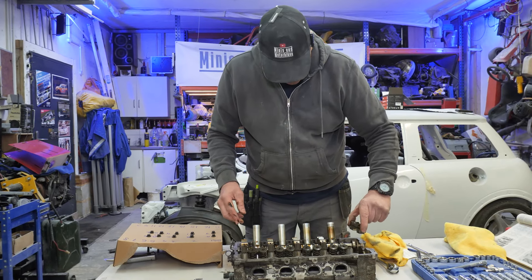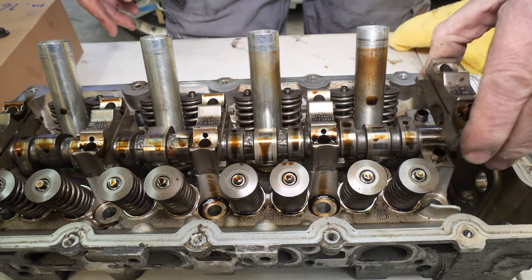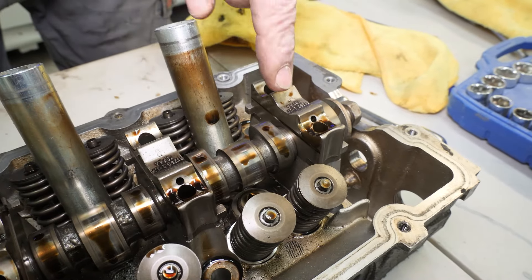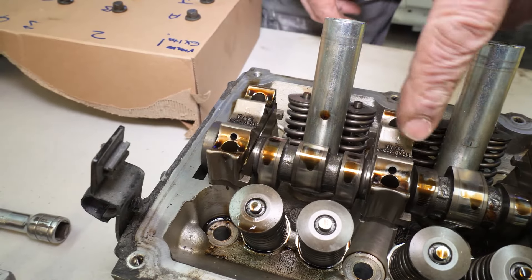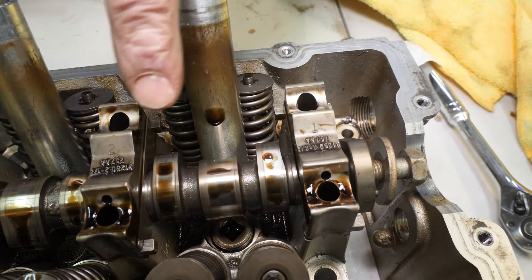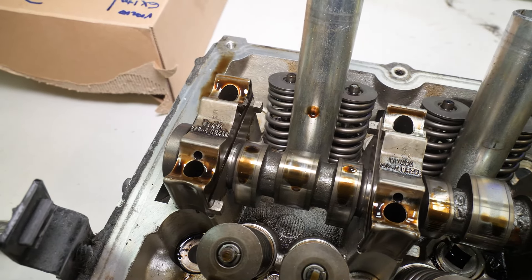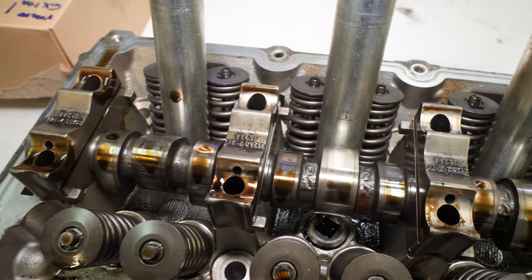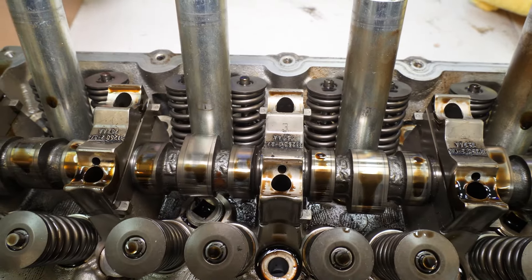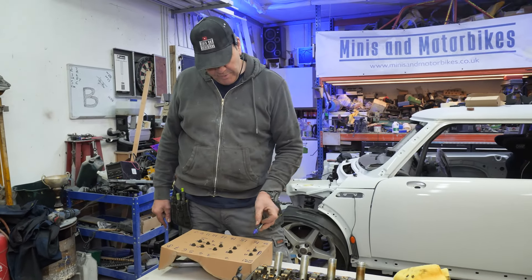See there — the cam is coming out. Do that again. Oh! See the cam. But they're marked differently, aren't they? No, look — one, two, three, four, five. They've got a mark on them which you couldn't see before. Where? Look — one, two, engraved, three, four, five. Yeah, but you've got to remember which way round, because you could start putting them back as one, two, three, four, five and only three would be right. It's from the chain end — it all works back that way.